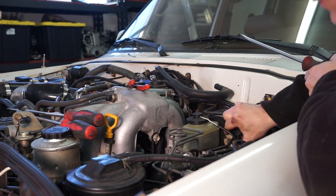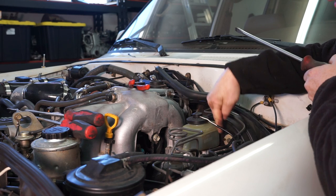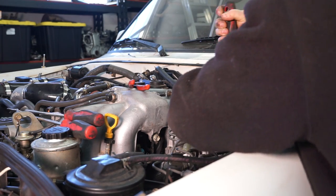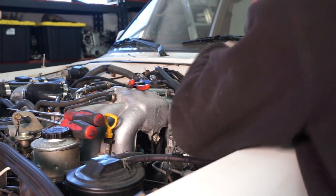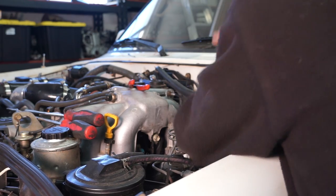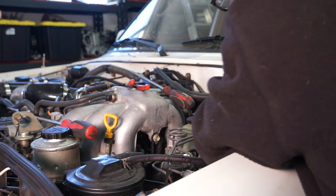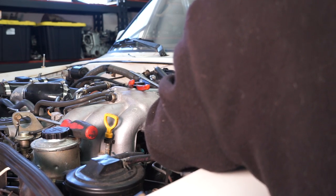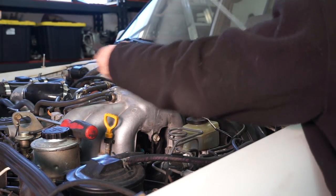And normally, where the check valve goes in, there would be a little metal bracket going from the top brake master stud over this little roll pin right here that would retain that. This truck is missing that, so I'm gonna have to order one before we're all the way finished. That guy's really stuck in there. Got it. I'm gonna go ahead and take the grommet out as well. There we go, old grommet's out.